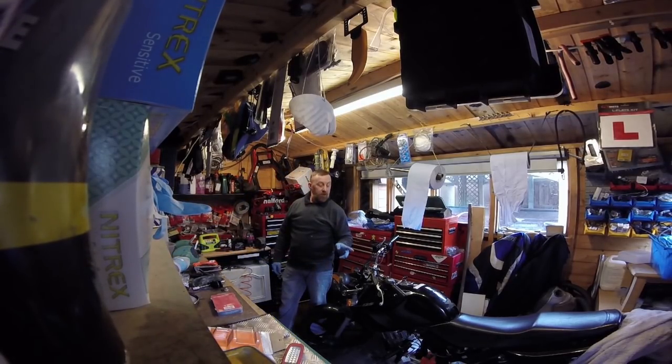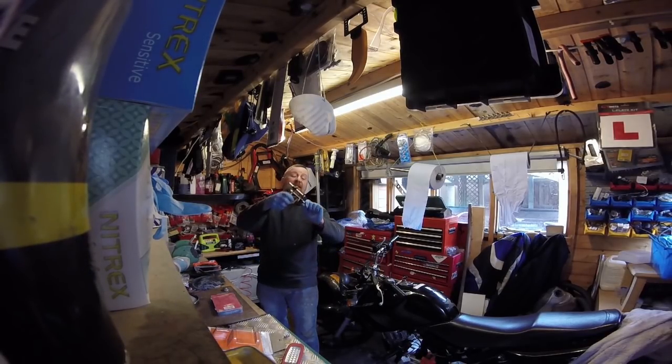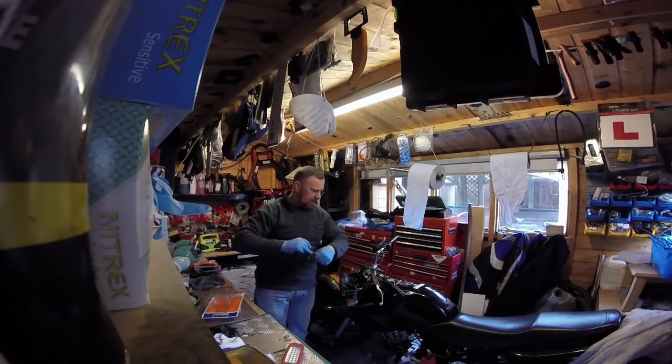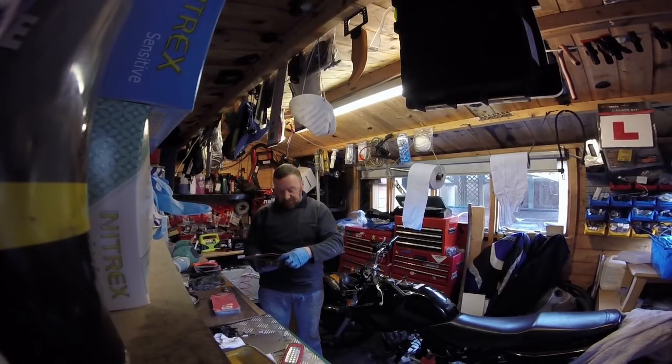What came in the post? These are really handy. The battery is on charge and did really well last night. I charged it three days ago - it's pumping in there, 12.31 volts this morning. Doesn't mean the amps are there though - just because the volts are there doesn't mean it will kick over the bike. It's the amps that kick over. This is a great tool from Draper - available on eBay.